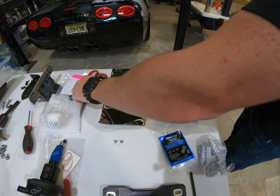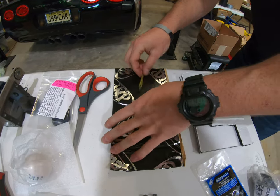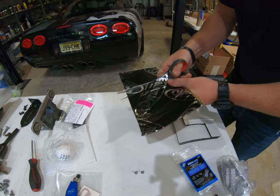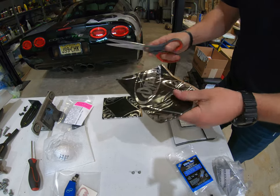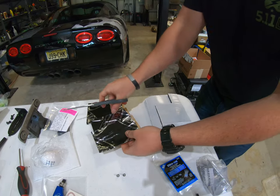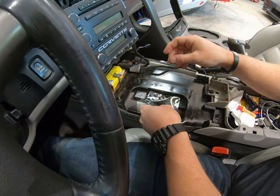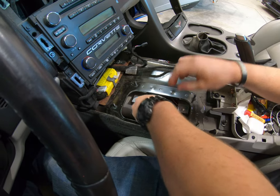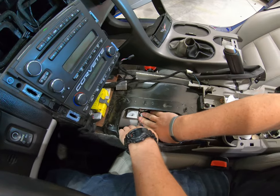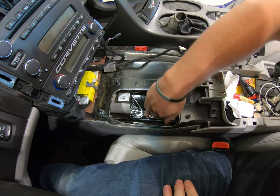So since you guys already cleaned your torque tube, now we're going to go ahead and cut up this dynamat. Get four inches first — so we're going to cut four inches off of it. And then you're going to cut what's remaining directly in half. Now you're going to take that dynamat — the one you cut into four inches — and put it right between here. It's super, super sticky. Get that installed right in there like that.